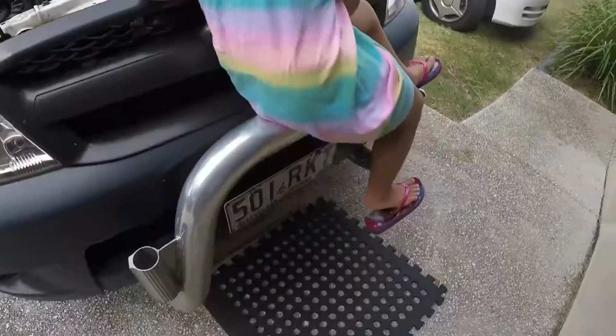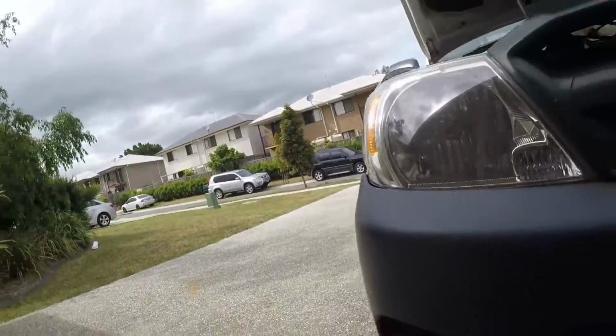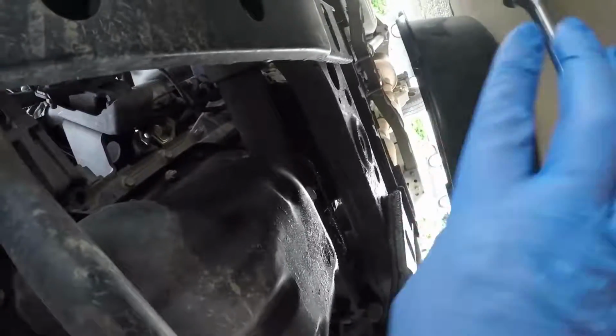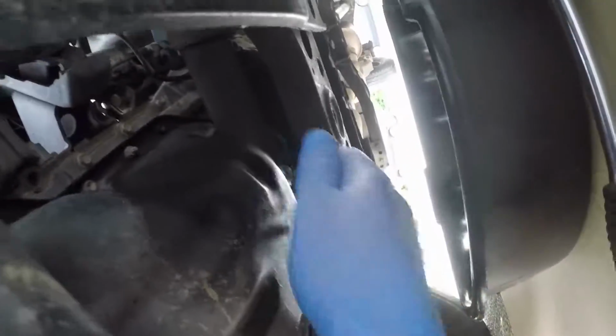First we're going to put the oil pan underneath the sump. Then we're going to go underneath here. Always lay cardboard down on the ground so you don't spill on your driveway. Gonna loosen up that bolt right there. That's gonna let your oil drain. It's not draining. Not yet, but it will.